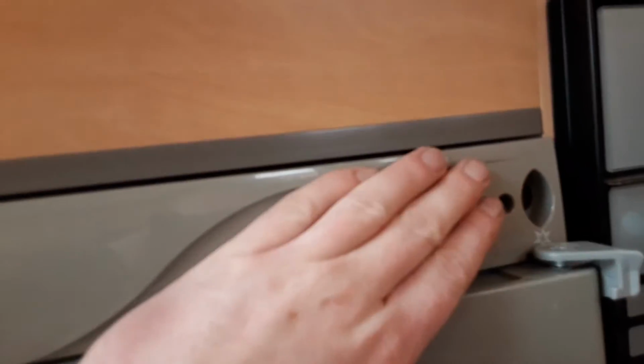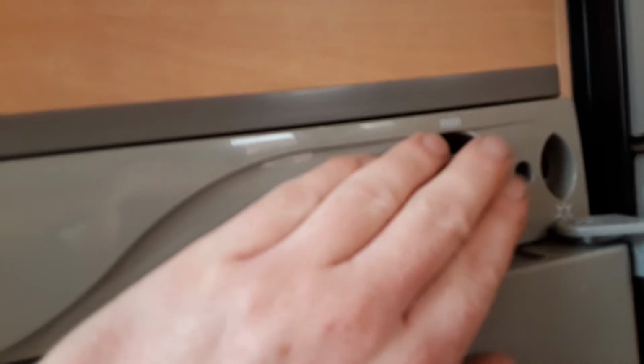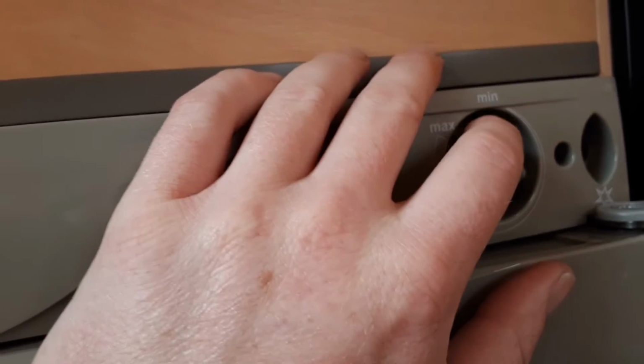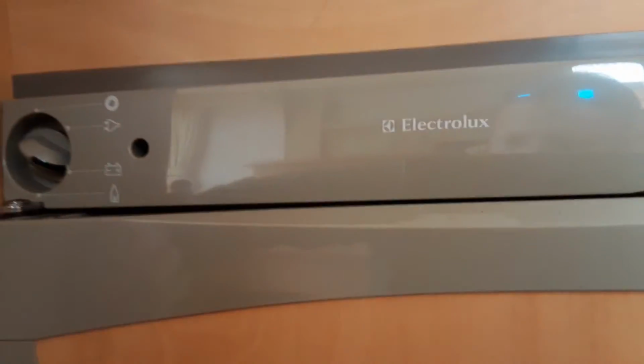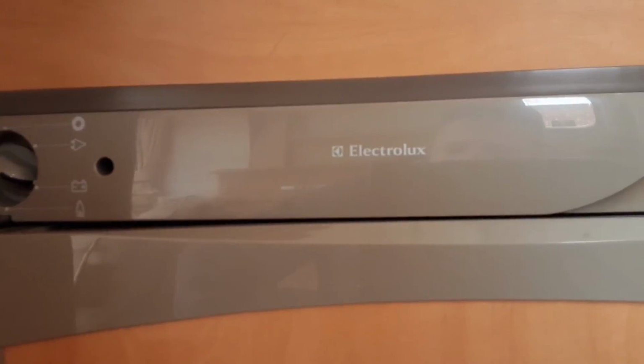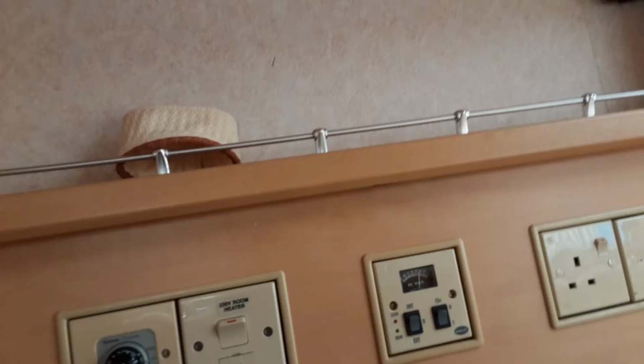You will have no temperature control when you're using the fridge on cool box mode, as it doesn't operate as a fridge at that point. Like I said, it is just a cool box. You will need to have the right connections on the car for this to work, and you do not need to have the 12 volt power switch on the wall turned on.